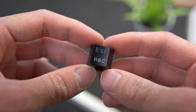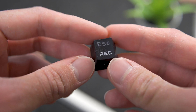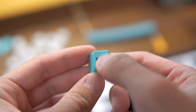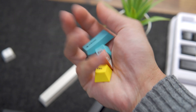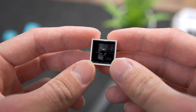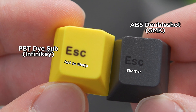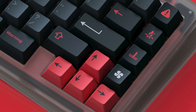There are three main ways keycaps are made: laser etched, dye sublimated, and double shot. Laser etching simply prints legends on the keycap, which will eventually fade. With dye sublimation, dyes are infused directly into the plastic, making legends very durable, though colorways are limited. Double shot uses two layers of differently colored plastic — one for the keycap and one for the legend — making it the most durable with the cleanest legends and richest colors like those found on GMK keycaps, but it requires molds for each key, making new fonts and designs more expensive.